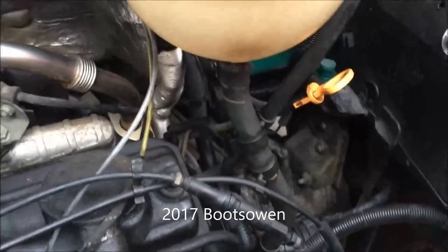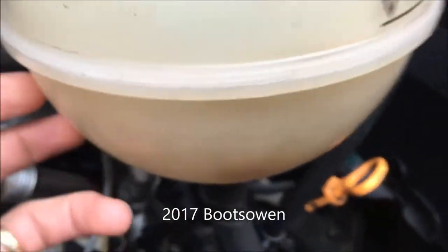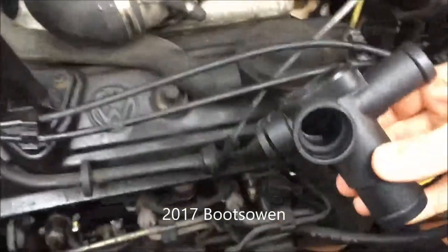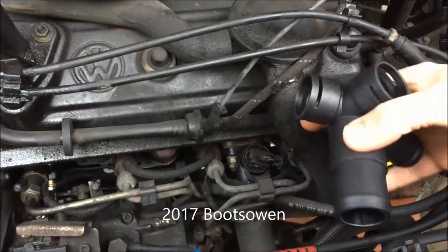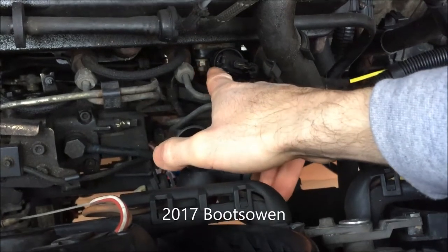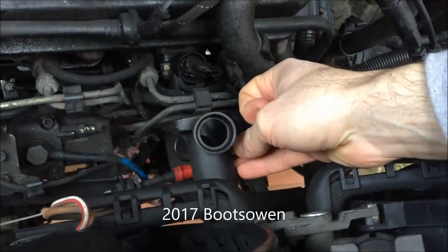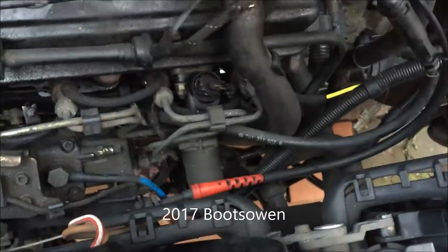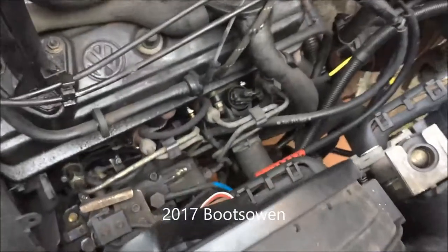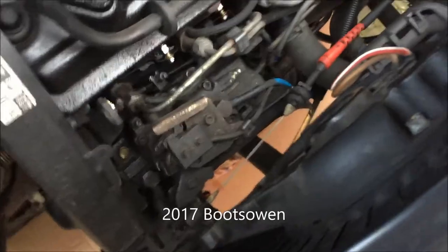Over the last week I've been waiting for parts to come — a new manifold for the coolant system and the alternator belt. In the meantime the coolant tank has emptied out again. What I reckon the problem is is this manifold here — this is the replacement manifold. It takes an orientation like this and replaces the one down here. That's one of the bolts for it and that's where one of the water temperature sensors goes in. I've got the radiator lifted out, so it should just be a matter of unscrewing it and swapping it out. Before I do that I've got to get underneath and let one of the hoses loose to let the water out of the coolant system.